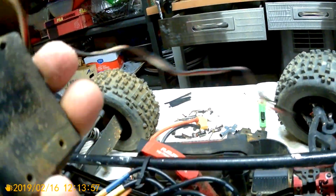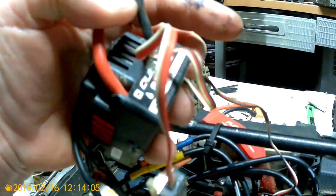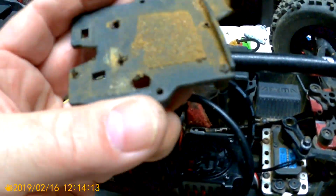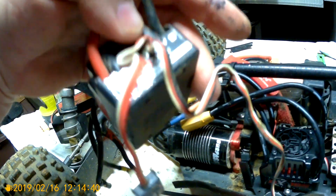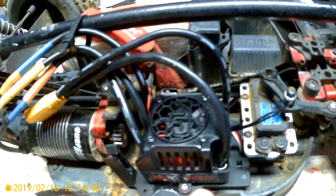This was my Quick One. Now on my other video I showed you, this was messed up from the beginning. This wire right here, if you mount it on your regular mount the way it is, and then this hooks onto, goes right in here, the wire coming out cuts on it. It's at the exact same height as this Vector Hobby servo mount, and it literally cuts that right there. So I had problems with it, so I took it apart, figured out what it was, and then I did my method over here.